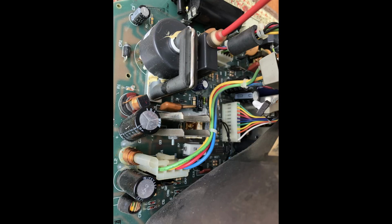What do you think it does to the already taxed analog power supply board that the early Mac suffered from overheating? Well, this upgraded model still needs an analog board capacitor and solder joint fix. It actually has melted connectors on the analog board, so that's a fix for another day. And the upgrade, although much needed, would probably have been something that Steve Jobs would have never signed off on.